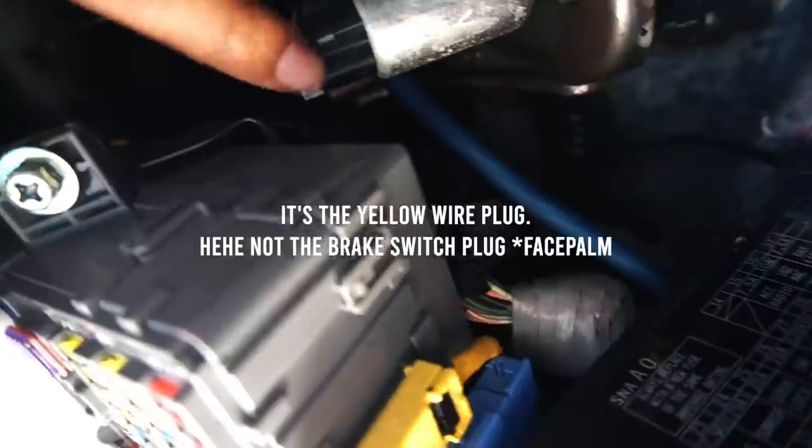All right, it's as clean as I'm gonna get it. Now, let me just remove my camera holder mount thing. All right, so what we're about to do right now is basically bypass this. This switch right here is your clutch switch. So whenever your clutch switch goes bad and you can't start the car, like, what the hell's going on? It's probably because of the switch.